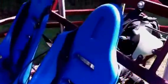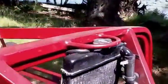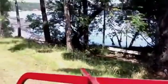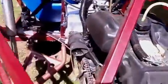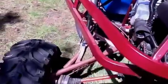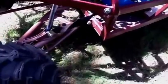Got the safety harness seats. Got the radiator overflow — you can see up top here. I've got a little bar because I've got a lot of trees and branches going through. You can see the Fox racing shocks — quite a bit of travel on this thing, it's just amazing. You can really go fast over the bumps. There are limiting straps so you don't bottom out the shocks and dump the balls out of the CV joints.